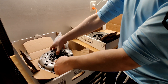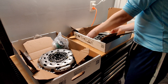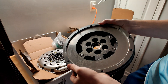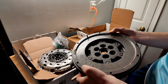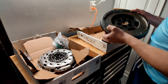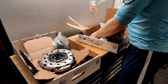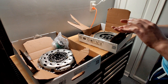The biggest difference is probably with the flywheel. The old flywheel — you can see the heat spots from wear and age. It's probably an original flywheel, never been replaced. But this one, you can see all the little ridges are still completely intact, and that should give it a lot of grip. Flywheels are pretty heavy generally — I think this one was like 23 pounds.